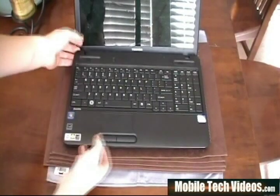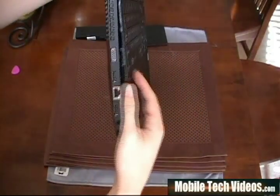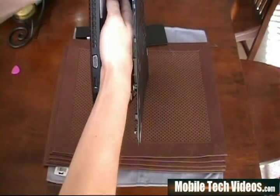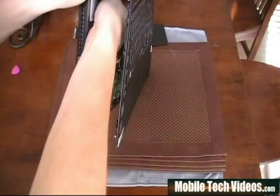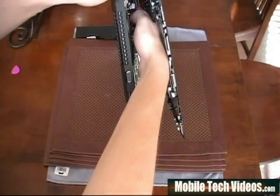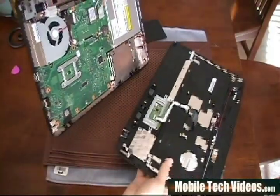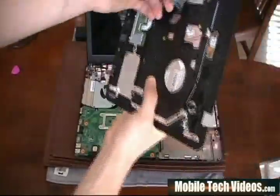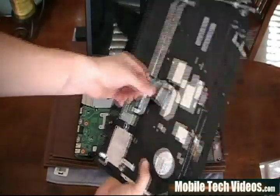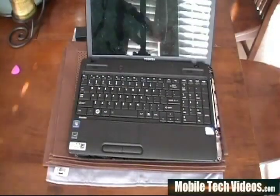Now we've somewhat separated our panel. We'll notice that it's still being held in a small spot due to a connector right in here. Get your hand in there and try to jar that loose — you can kind of just pull it basically. Once that's disconnected and the next one too, it will literally fall right out of place. Keep in mind that you will need to get the keyboard ribbon cable done if it doesn't come out as easily. We'll talk about putting that back on once we get ready to start replacing the LCD.